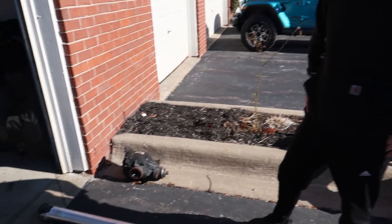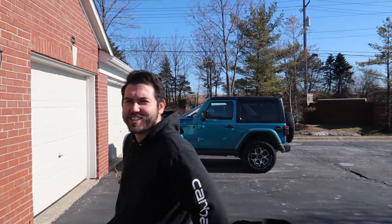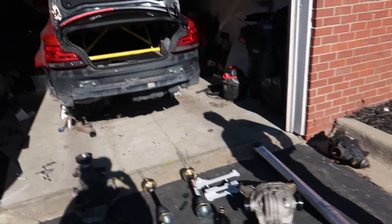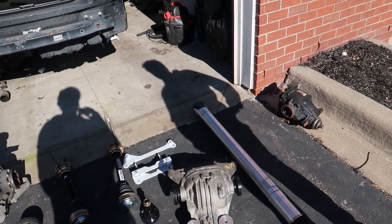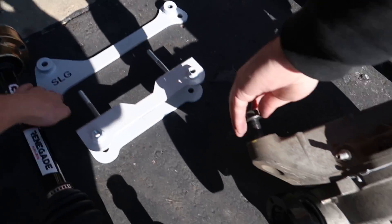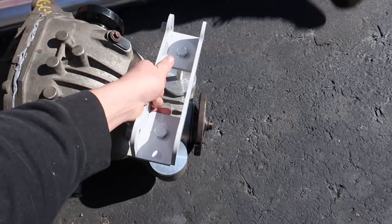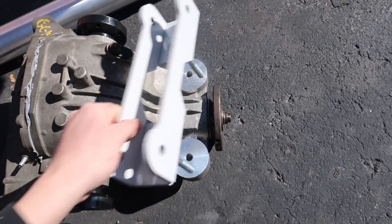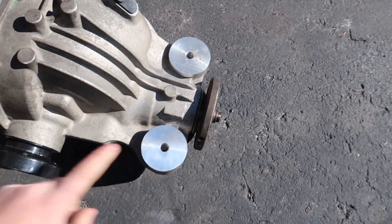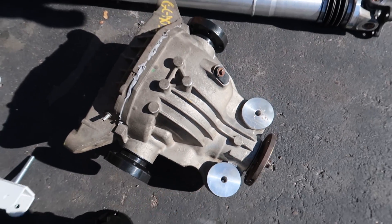Finally beautiful — let's put it in the car. It's a brisk 44 degrees here in Michigan — I feel like we're in Florida. So what's first? Let's bolt the bracket to the diff, then load the diff in the subframe. You want to put this one in the subframe first, then put this one on the diff. These are our aluminum bushings — you can order them with your diff or separately. These press in where the really soft factory bushings would go.